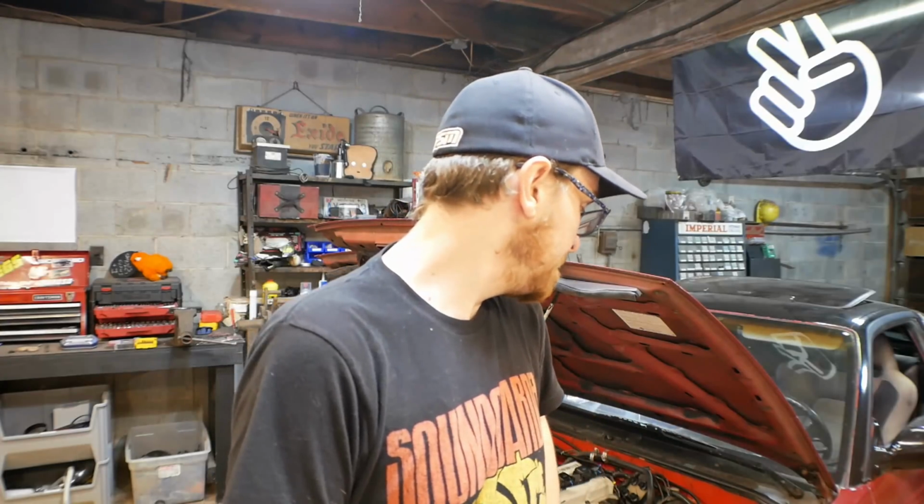The number one thing is we were following a thread of somebody else that was doing this, and in that case, they were using a wasted spark setup, not a sequential ignition setup, not a fully independent setup like we were trying to do. In fact, I had done pretty extensive modification to the ECU to accomplish that, but we didn't have enough inputs on the ECU to have everything we needed. As far as we could tell, nobody has written about doing this with our computer, which, by the way, is a Megasquirt MS2 3.0. So we were kind of flying blind with that stuff.